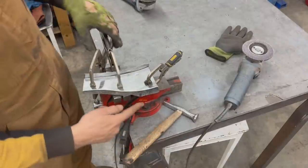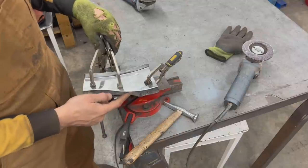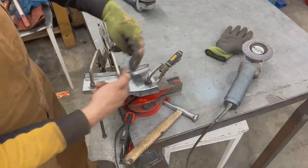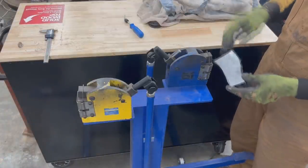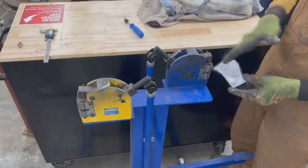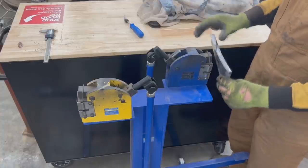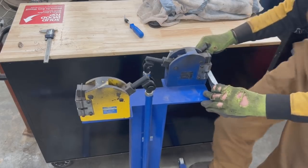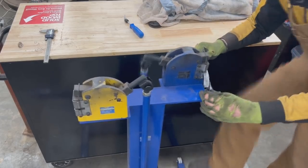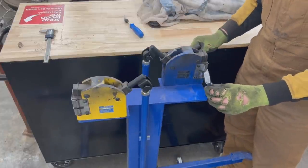Okay. So this flange is a little bit curled, but that doesn't matter because we have to stretch it anyway. So we're gonna start shrinking this side, and this is gonna have to be stretched anyways. So we have to start shrinking this flange in order to get this shape. So I'm gonna flip it around actually. And the shrinking has to happen mostly in the center here.